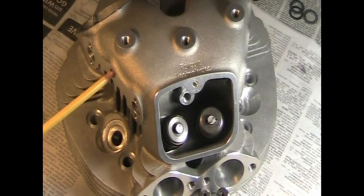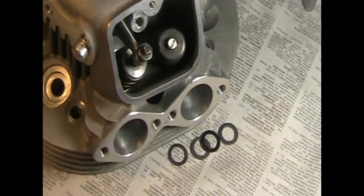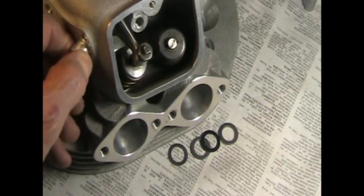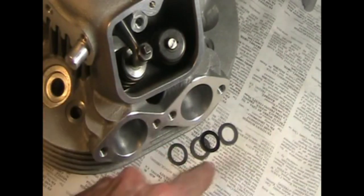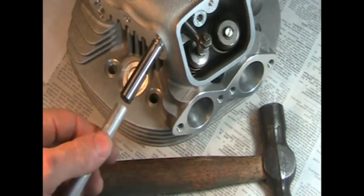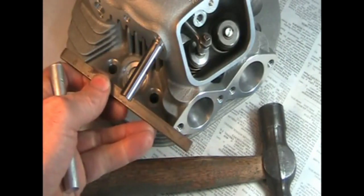You'll have to plug this banjo fitting. When you're ready to install the rocker arms on a race engine, you can get rid of these spindle springs and save a little friction. Replace them with shims and spacers. Make yourself a temporary aluminum rocker spindle about 2 or 3 thousandths smaller in diameter. That way you can slide it in and out easily and determine the thickness of your shim pack before final assembly. When you're ready to install the spindle, align the flats so they're facing outwards. Heat the head up and drive them in with an aluminum punch. Have a steel strap ready to align the spindle and turn it as you go if necessary.